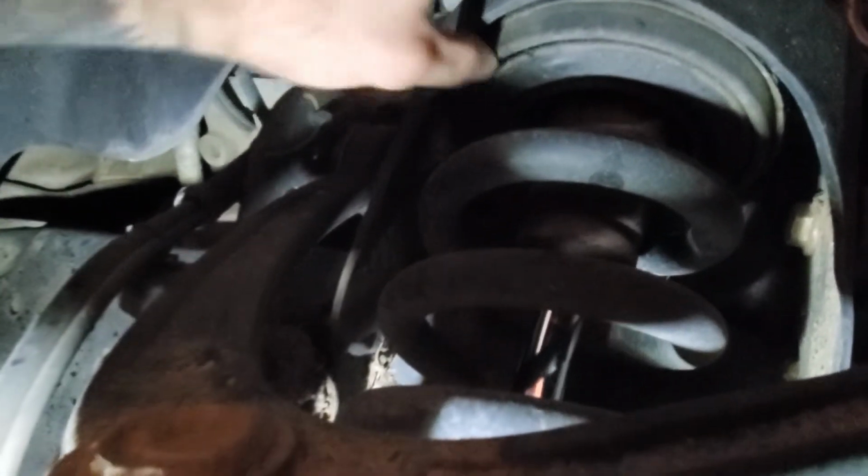Bought this truck. The shocks didn't look great. They do have some corrosion on them. And then I'm checking for broken bushings on the bottom. Up on the top, inside of here, you'll see sometimes it'll start falling out when it's bad. Make sure the spring's not broken anywhere. No visible cracks. And the big thing I'm looking for is leaky shocks, which this one is leaking.